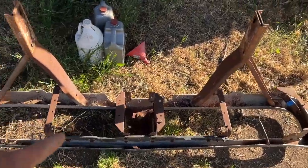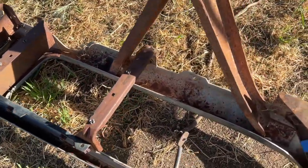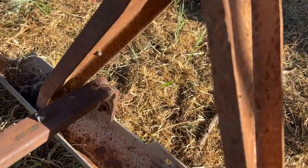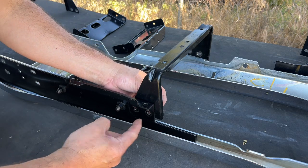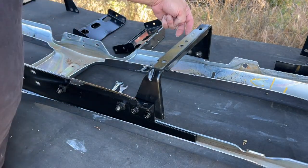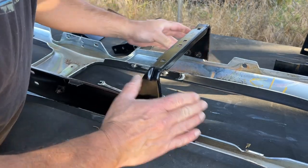All right, so I moved Dylan's bumper over here for orientation to match the bumper on the bench. And I'm gonna put this piece in next so we can see that this angled side has to point inward. This part's gonna go underneath this bracket, and it's gonna go on top of the bumper ledge or edge. And the bolts, when they go through, they're gonna go through in the upward direction on the top. Now on the bottom, they'll also go in the upward direction.